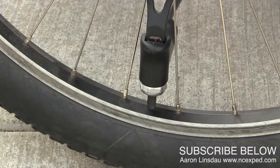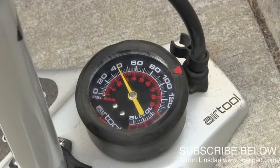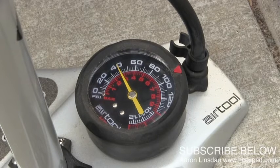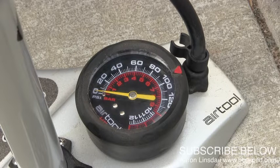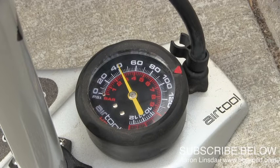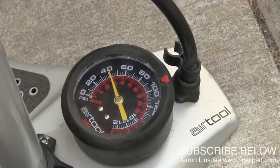And there we are. So I'm going to show you what it looks like on the pump side when I lock this in, and I'll narrate when the pump is locked in, and you'll see that happen. So I unlock the head. Let me see, right. I unlock the head, nothing, and then I pull up. And there you go. So I'm going to push down and then throw the lock on the head, and the lock is when the valve is pushed. So when you push this particular head onto a Schrader valve, it doesn't air out like other valves, which is really nice.